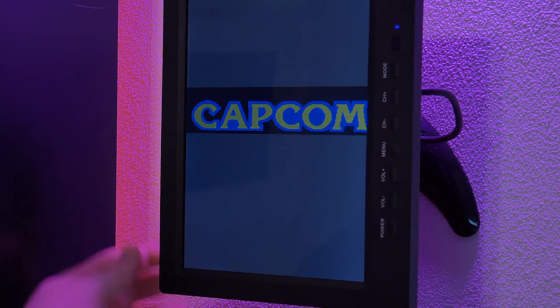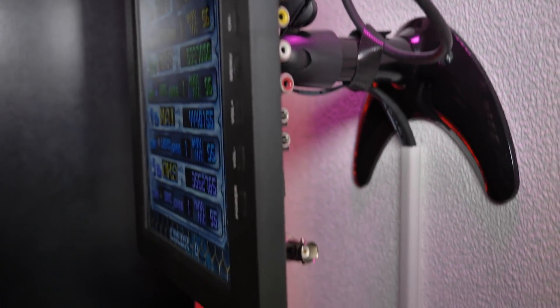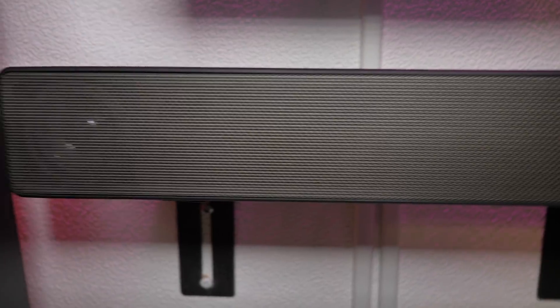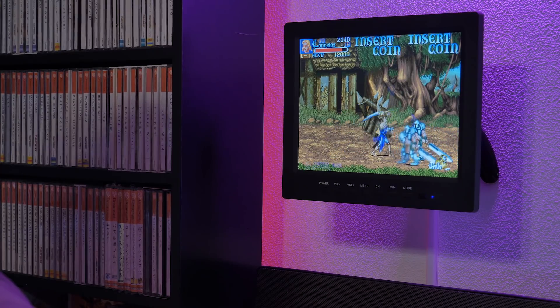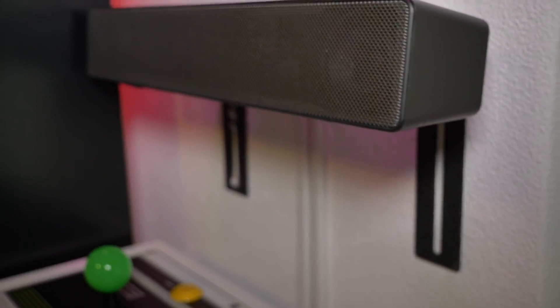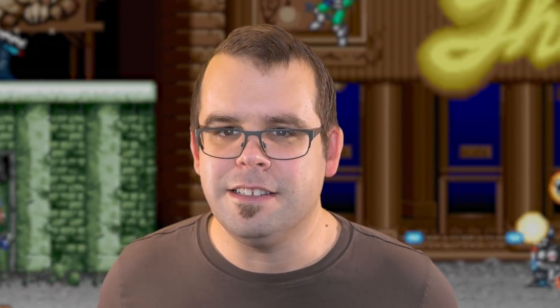You can go as big or as small as you like, but you should try to find a size that's comfortable for your specific viewing distance. With the screen mounted, I ran the cables down the wall to a surge protector below, and of course to the MiSTer itself. Next up is the audio — most screens have built-in speakers already, but I wanted something that sounded a little better, so I went with this cheap sound bar. I think it was 29 euros on Amazon. It's powered by USB, has its own internal battery, and can accept analog audio input. Because the MiSTer has plenty of USB ports available when using the USB hub, I was able to plug it right in there, and it receives power from the MiSTer when it's running. So I have video output on the small LCD screen and audio coming from the sound bar. I mounted the sound bar using these L brackets — not the neatest installation, but it gets the job done.